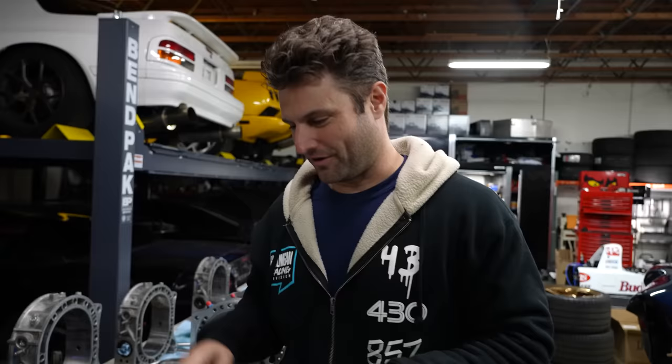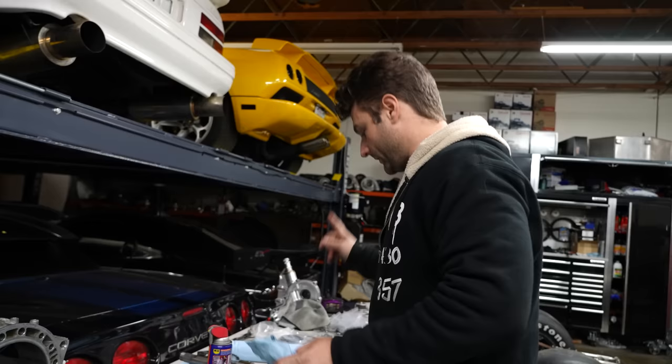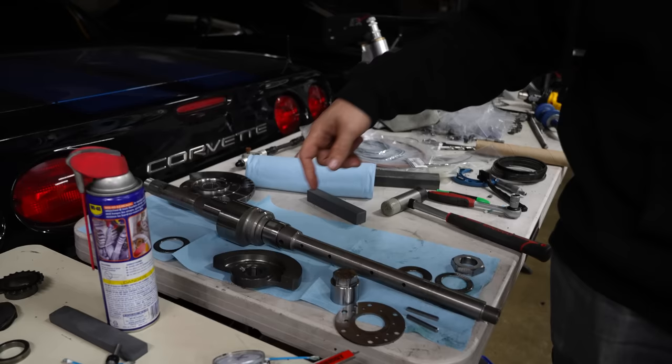They all are in. So you can see all four have the deeper groove, and just by the shadow, you can tell that alone. Everything's reading 4. So what that means is that all of these bearings are 4 thousandths bigger than the ideal lobe. This lobe is the ideal size. The other three are actually 0.5 thousandths larger, so technically my bearing clearance is closer to 3.5 to 4, somewhere in there, but rotor 3 is very distinctly 4.